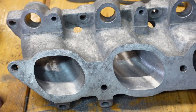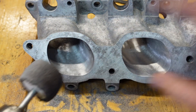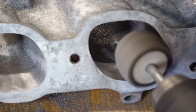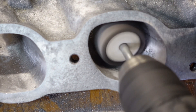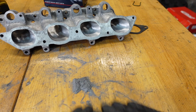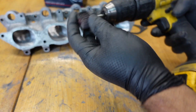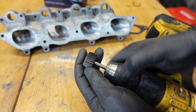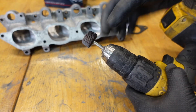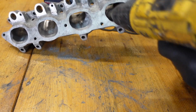This bend is why we're doing this. I'm going to continue - as you can see I've just started this one. I go at it first with the bigger bit - I think this is actually 80 grit, it's a bigger disc - and then the little corners that are left you go over with the smaller wheels to get the majority done. It doesn't get into all the little gaps. There's quite a pile of material that's come off. Moving on to the 60 grit smaller one. It does come in handy if you've got a die grinder, because you're limited by how far you can go in the short space, but luckily this is quite a short part and we can get into it very nicely.